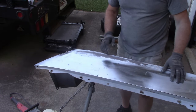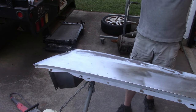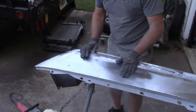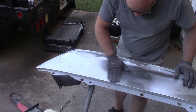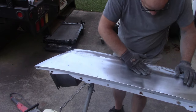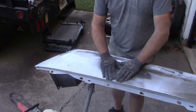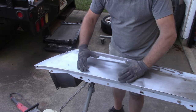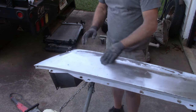These fenders are so thin and this panel area is so flat that it doesn't have a lot of strength. If they had some sort of curve anywhere, this area would be a lot stronger. I can feel there's a low spot here and a little bit along in here. Sometimes you have to fill a wider area - you can't just fill one little spot. You've got to fill it big so that it transitions out. But it is a solid fender - I'll give them that.